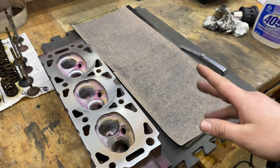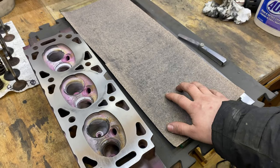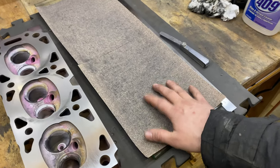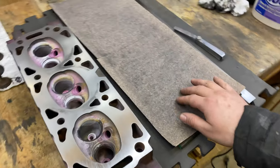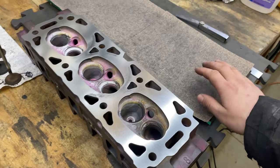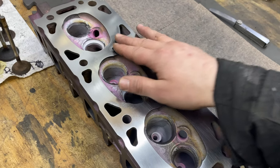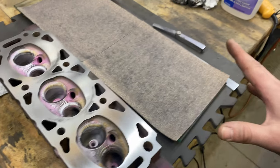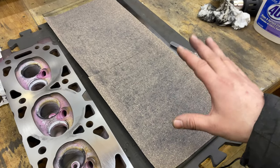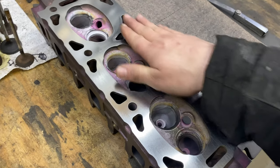It took me, I don't know, maybe 45 minutes with the 60 grits. And this 60 grit here at this point is pretty much worn out. It feels like 400 when you go across it. So if I was going to do this further, I would need probably two more sheets, I think, to do it here, everyone. The 60 grit took it down pretty quick. I was hoping maybe they'd have a little bit coarser grit, like 30 or something, but they did not.